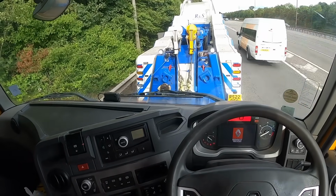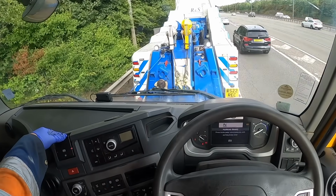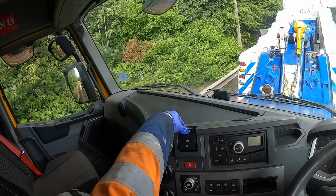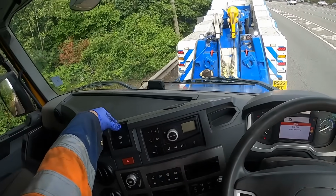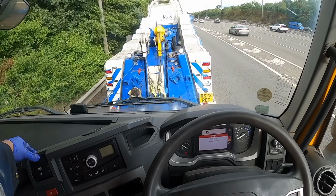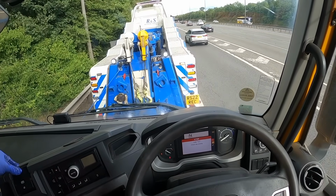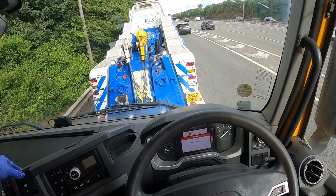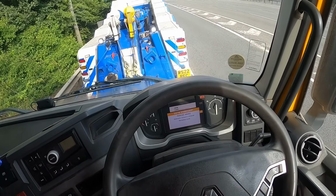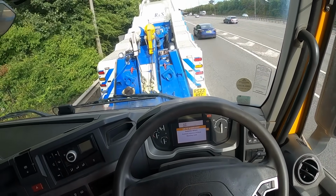Right, okay. So we can get the handbrake off. Right, okay, that's the handbrake off. Got the ignition on. Cab tilt locking, yeah. The cab's been lifted actually. We have checked the cab's in, it stops. And hopefully we should have a workshop mode. Here we are, parking brake, automatic actuation, inhibited workshop mode.